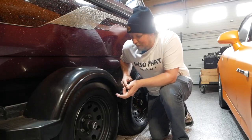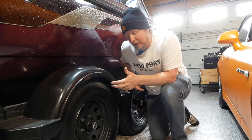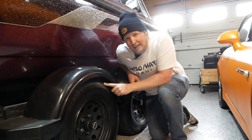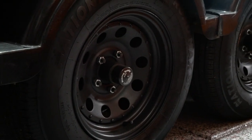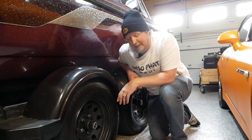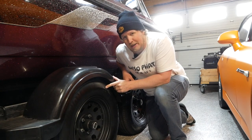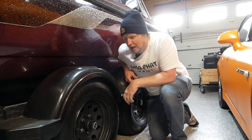The last order of business is trailer stuff. First, make sure your trailer is registered — you don't want to get pulled over. Second, check your tire pressure. Trailer tires often run at much higher PSI than car tires because they have thicker walls for heavier loads. My boat rigs in around 4,800 pounds, and with the trailer probably around 6,000 pounds total. My trailer tires can go up to 50 PSI; I have them set at about 45.